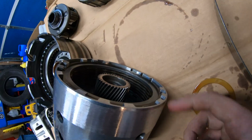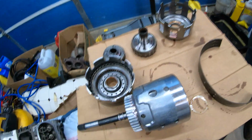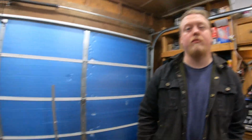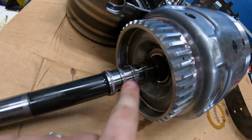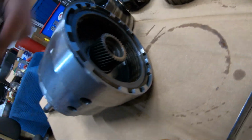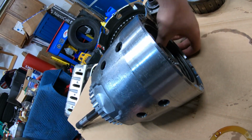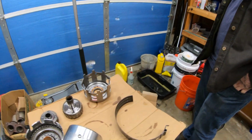See in there, there's one of those other snap rings, just like this one here. These are actually really easy to get out. And then all these clutches that are lined up in here come out. Another really cool thing that he showed in the video is how to test this before he put it back, because you can see on here the input shaft has all these holes. These are hydraulic areas where fluid is pumped through to engage them. So you can put compressed air and you actually see the band push forward and engage. So very cool. And also that's where the hardened reinforced drum thing is for the input shaft, whatever it is.